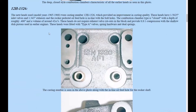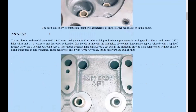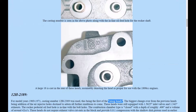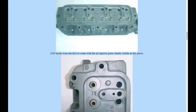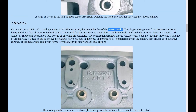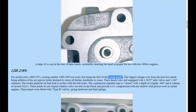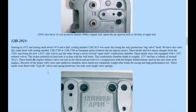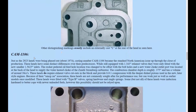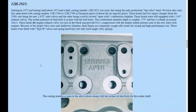Obviously with the Mark 1s, you don't have the smog heads, so you won't have those little ports on the side. On the 2389 head, you can see where the air port is right here on this first bolt hole, whereas on the earlier heads, there's no air port there at all. That's a significant distinguishing feature when looking from the outside.